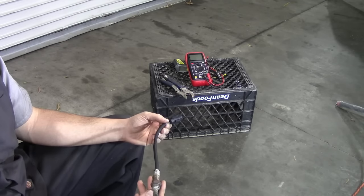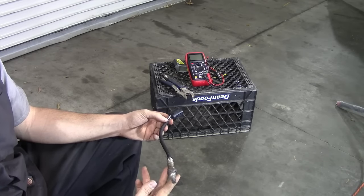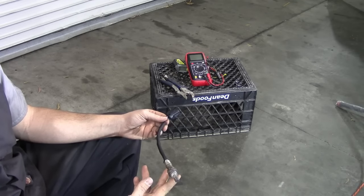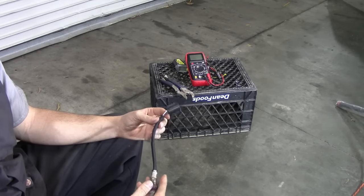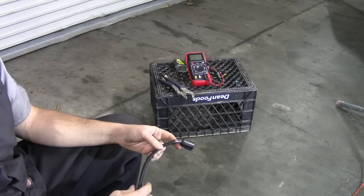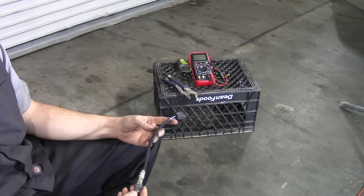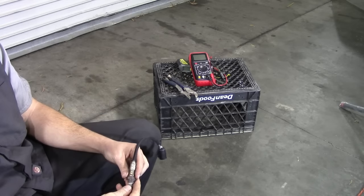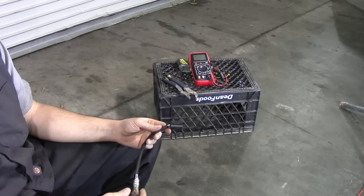As you may know, an oxygen sensor is a voltage-producing sensor. They measure the amount of oxygen in the exhaust fumes coming out of your combustion chambers and produce a voltage based on that reading. They send that voltage to your ECU, and your ECU uses it to fix the air-fuel mixture going to your engine. If you have a sensor that only has one wire, that one wire is the signal wire — the wire that sends the voltage reading to your ECU — and those sensors are grounded through the exhaust pipe and your chassis.